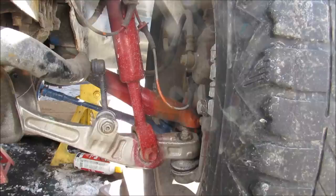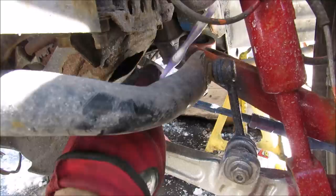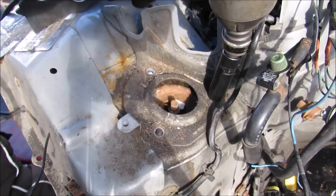Here we've got a good shot of the two ball joints on the suspension. This one goes to the compression rod which goes towards the back. Then we have the cross link over here that has the shock attached to it as well as the stabilizer link. The compression link mounts to the body at the back, while the cross link over here mounts to the subframe.